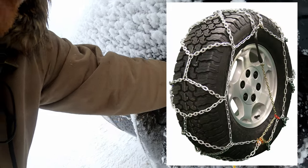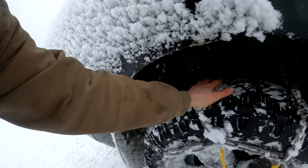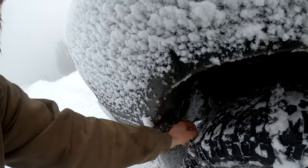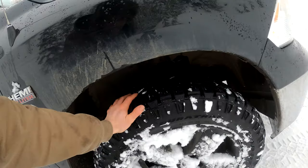These V-bar chains tend to have a lot more grip than what you would call your highway chains. Highway chains literally just have chain link across the wheel — they're great for ice and great on the highway. V-bar chains are much better in deep snow and even in mud, actually. Originally I'm from the east coast and chains aren't really a thing at all. Not until I came out to the west coast do you actually see signs that say chains must be on no matter what, even if you have winter tires — even with a really nice set of Wrangler Dura-Tracs, which are pretty highly rated in snow and ice, they still wouldn't let you up certain roads or passes in certain weather conditions.